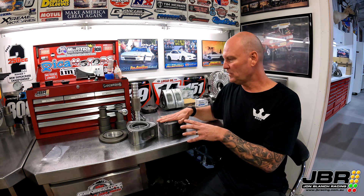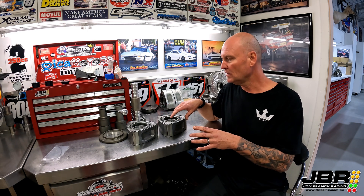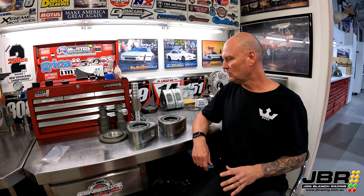So I looked a little bit deeper into it — I pulled the springs out and laid them on the bench side by side, and there was a noticeable difference in the free height of the side seal springs. Now these are all springs that have just come straight from Mazda, they're all brand new, no secondhand ones or any funny business — all straight out of the packet. Lined up alongside each other there were probably three or four that were the same, some are worse than others, some are normal. I'll try and zoom in with the camera and give you a closer look at what you need to be looking for when you're checking this stuff.